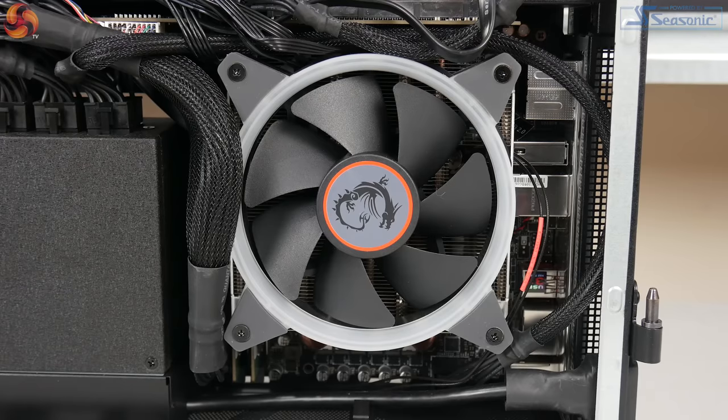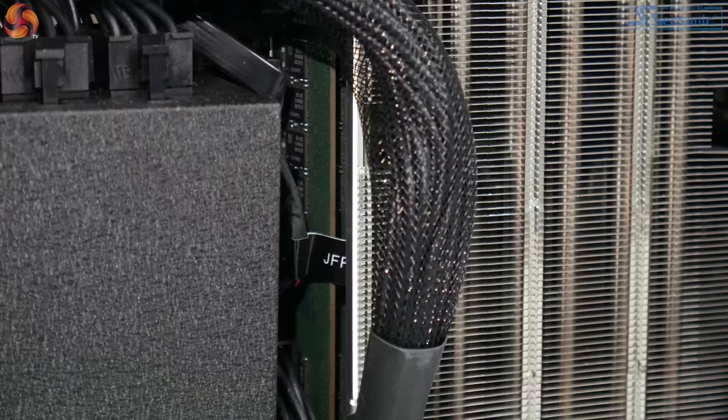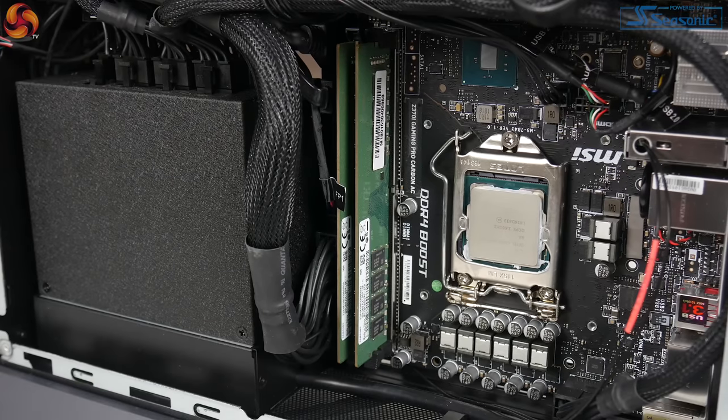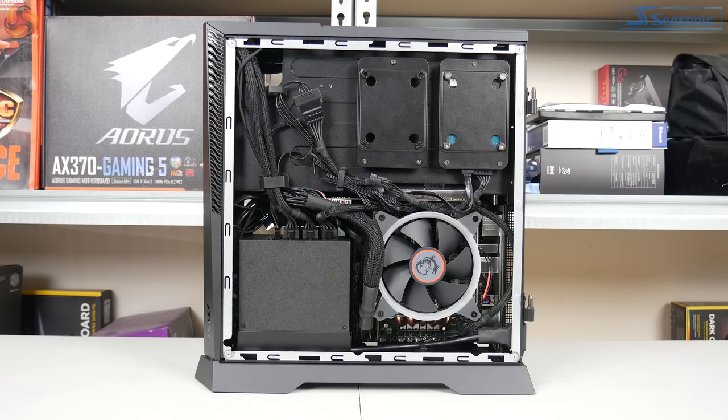Cooling the processor is a fairly average-looking low-profile cooler with five heat pipes and a single 120mm fan. Just to the left of that you can just about see the two 16GB modules of DDR4 memory at 2666MHz. The frequency is fine — it's obviously not the fastest out there, but it doesn't matter as much on an Intel platform as it does for AMD. The thing that bothers me, though, is that MSI has gone with these plain green DIMMs with no heat spreader. In fairness, you really can't see them at all — they're obscured by the CPU cooler's fan and the motherboard's 24-pin cable — but it is a corner cut not to bother with heat-spreaded RAM at this price.